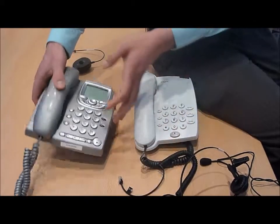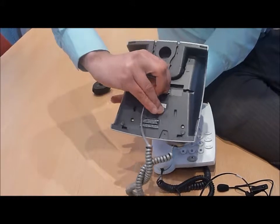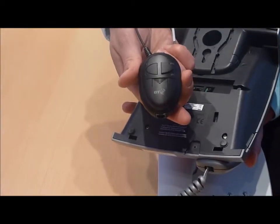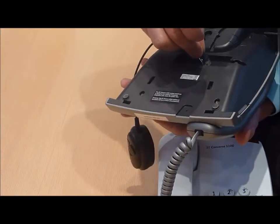For telephones without a dedicated headset port, simply remove the handset cable — the curled cable — from the base of the telephone. Take the configuration switch supplied with the BT Accord headset and plug this into the handset port at the base of the telephone from which the cable was previously removed.